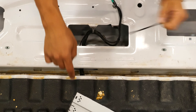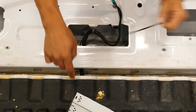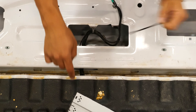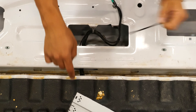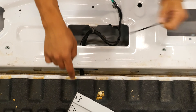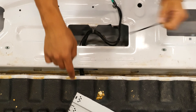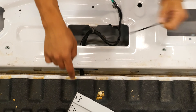For this next part of the install, I went ahead and grabbed some gloves, some zip ties, and some snips to cut the zip ties. Basically I'm going to be running the camera feed wire down the passenger side of the vehicle. Our exhaust system is also on the same side, so what you want to try to avoid is anything hot and anything moving. If you follow that factory wiring harness down the side of the vehicle, that's a pretty safe bet — the manufacturer put that harness in a very safe spot. Stay around the frame, away from the exhaust and the springs, and you should be fine. Let's jump underneath and start zip tying our wire to the front of the truck.